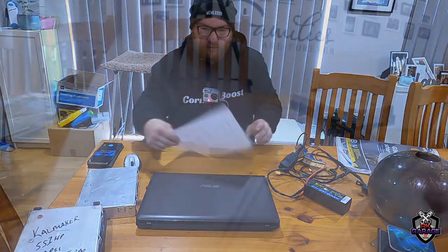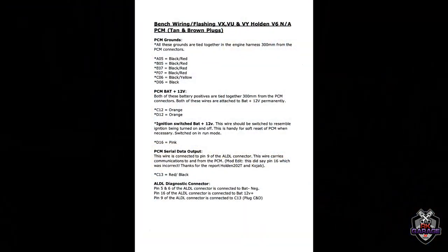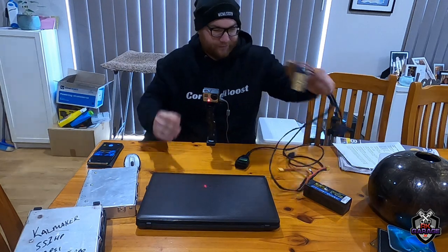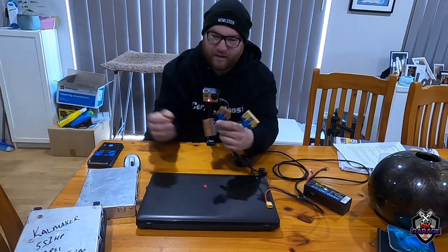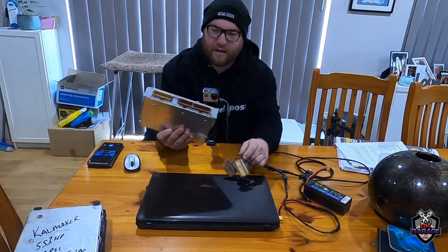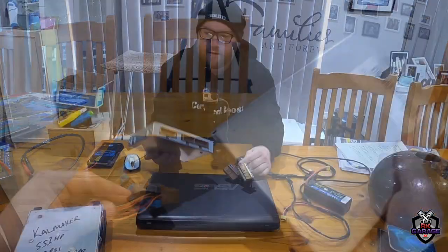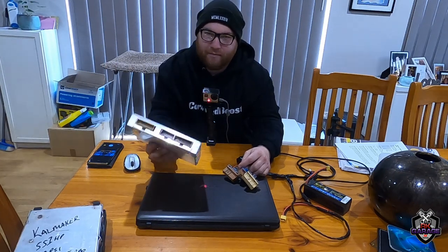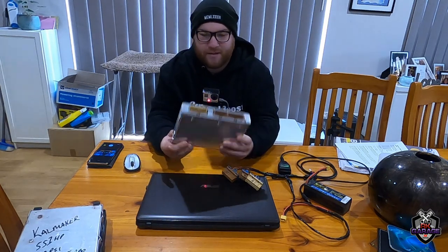So I went on to PCM Hacking and got this sheet here printed out, which I'll put up on the screen. I might save this so if anyone wants a copy they can contact me and I'll send it to them. The tan and brown colored ones are the flash-based ECUs. The blue and pink ones are the memcal-based ones and will not work for this, as they have a memcal — or a chip, as people called it in the olden days.